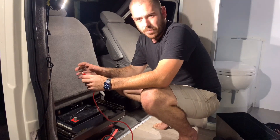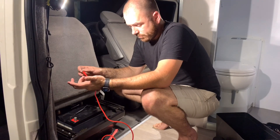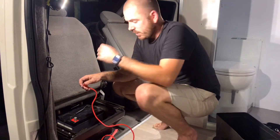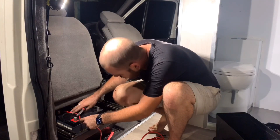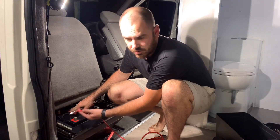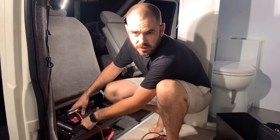If that part of the car is isolated, it may not be grounded. Just check that you have 12-point-whatever volts running through it with your multimeter. When measuring cable lengths, leave yourself a bit of wriggle room so the cables don't have to be pulled taut, but to keep things neat, don't make them too long either.